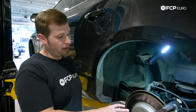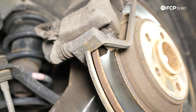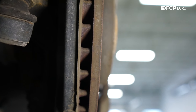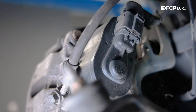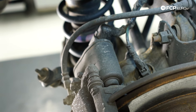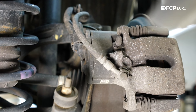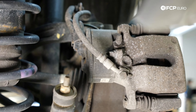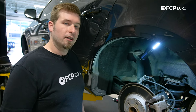As you can see, I have a solid rear setup on this. If you had a vented rear, you would be able to see the venting on top. You can also see there's an electronic parking brake unit. The only Volvo P3 that had a mechanical parking brake was a 2007 S80 — after that they all went to this electronic parking brake unit. There are a couple of ways to back that parking brake off when you're doing a brake job, and we're going to cover that a little bit later.